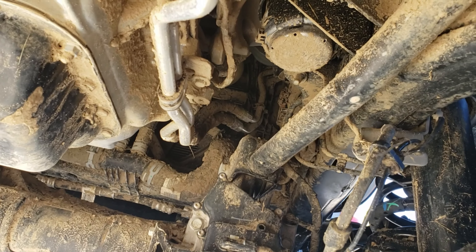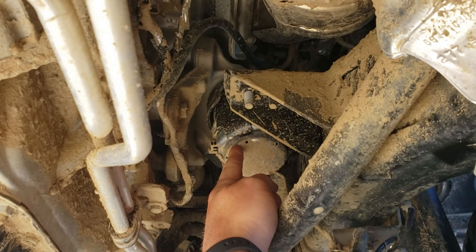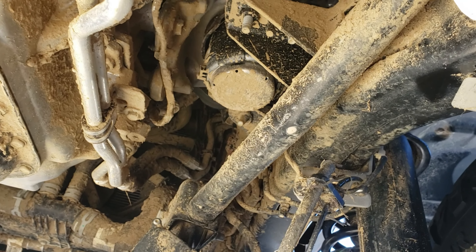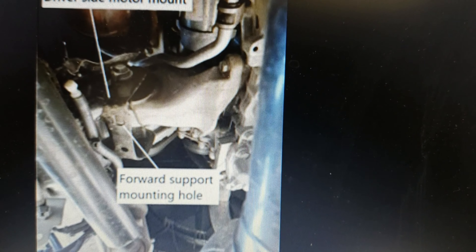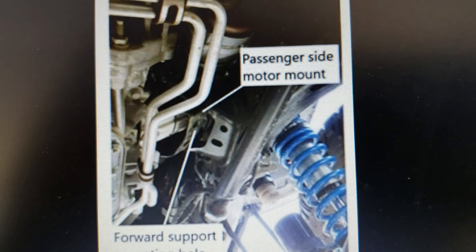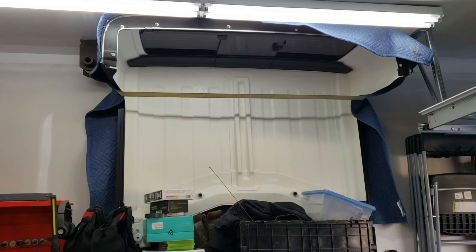I apologize — we just got it and went off-roading so things are a little dirty up here. Right here you can see the new engine mounts. The way these engine mounts are configured is different than on the JL. Before, they had more of a flat part coming down and that's what the skid plate bolted to. Here is a view of the motor mounts from the JL — as you can see the connection point is different. I'm pulling pictures from the actual install manual since I don't have a JL accessible right now. That's where those bolts normally go, and you can see on the passenger side there is a huge difference.